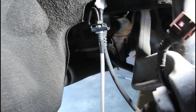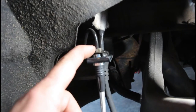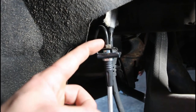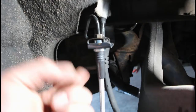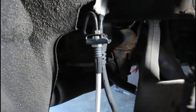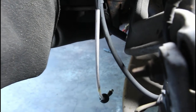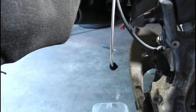In the meantime, I replaced the brake line — it's actually really easy to do. All you have to do is get an 11-mil line wrench, otherwise you could strip these. This one just screws right in, so it was fairly easy. We got some leaks, so I'm going to get a plug for that so it doesn't leak. We're going to flush out the brake fluid with new stuff anyway, but it's making a mess so let's clean it up.